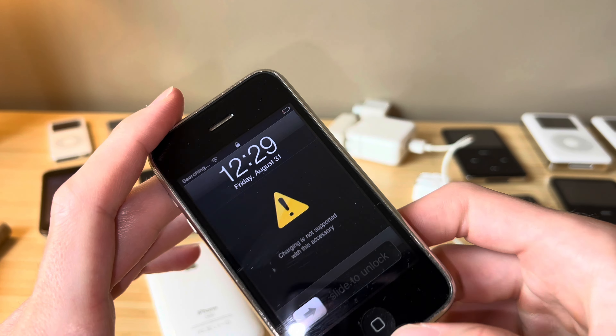So almost all of these devices are capable of charging with Firewire. All of the iPod Classics work. The first three iPod nanos work. First gen iPod touch and the iPhone 2G are able to charge using our Firewire connection. This Firewire brick looks quite different and is actually a pretty big power supply - much larger than even the 29-watt USB-C power adapter that shipped with the MacBook Airs. If you've got yourself an old iPod Classic and it won't turn on, see if you can get yourself one of these Firewire to 30-pin cables. A lot of times these older iPods need that little extra boost of power that Firewire is able to provide.